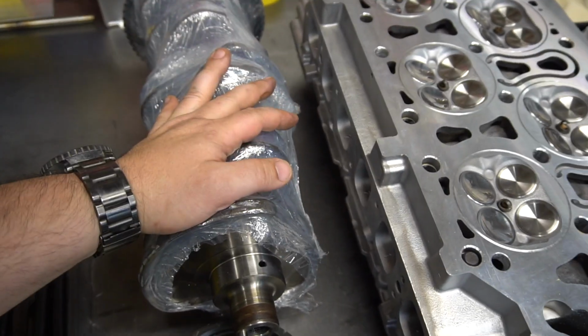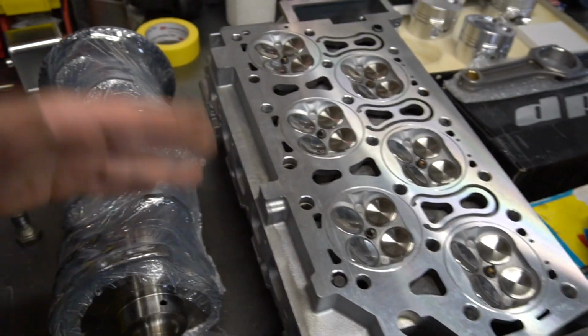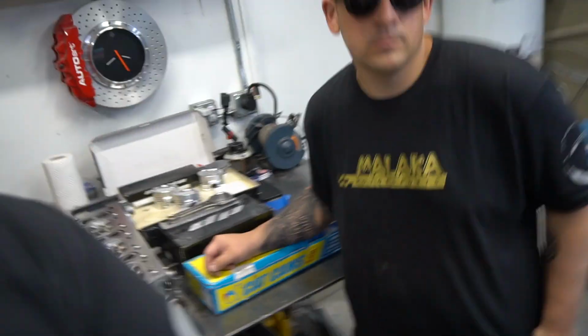But we are going to be using a 2.8 crank in the 3.2 liter to de-stroke. The reason why you de-stroke is we want to be able to rev higher and make more power in the high RPM. I don't know if we're going to be sticking with the RS3 transmission for the entire life of the car. If we ever want to switch, now we have an engine that can make boost and operate pretty much in every RPM, especially 9 or 10,000. Some of these guys in Europe are claiming 9,800 RPM in some of these VR6s.